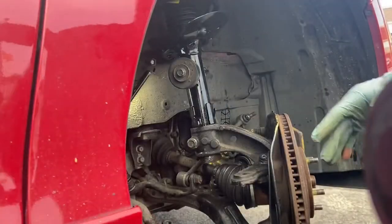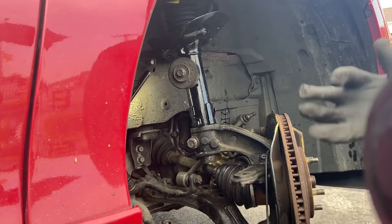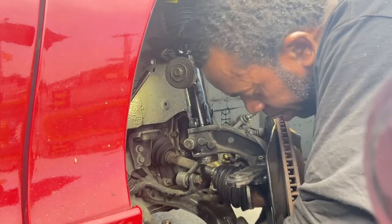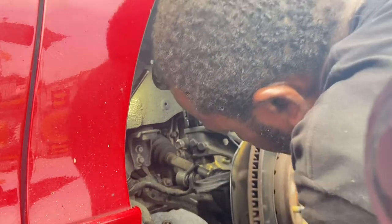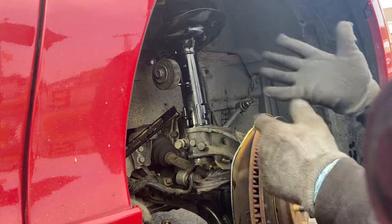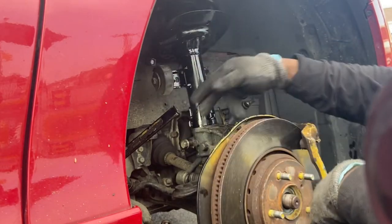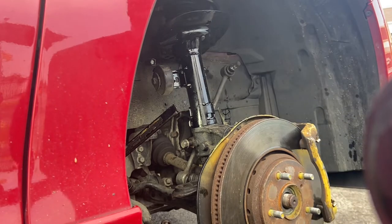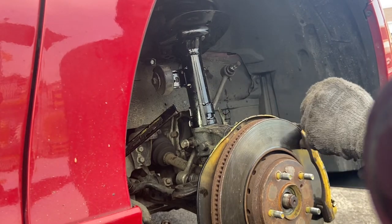You can see why you have to loosen everything — if you don't loosen that, you won't be able to take off the strut. You have to loosen the lower ball joint so you can press it down and put it back in. Without loosening that you won't be able to remove or reinstall it. With those explanations, everything is in — the strut is in — we're gonna tie everything back up. The axle is all in, so I'm not going to block the video showing that part.